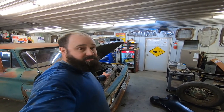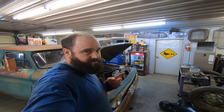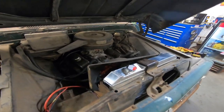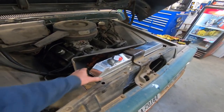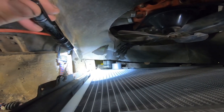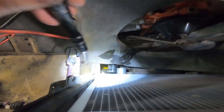Today, we're going to swap the radiator on Rex, my '66 Chevy half ton, small block, 5-speed. The old copper radiator is pretty crusty, so I bought an eBay special aluminum one, about 130 bucks. Duff is excited to get this going because this is the pickup he gets to ride in the most. So the first thing I did was take the old plastic petcock that comes with these things, it's garbage, and threaded the original one in there because it's a nice combination of steel and brass.